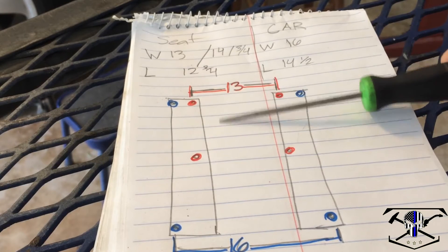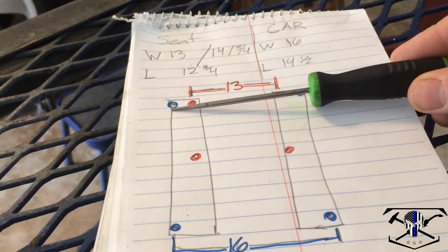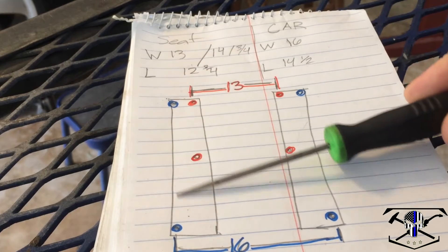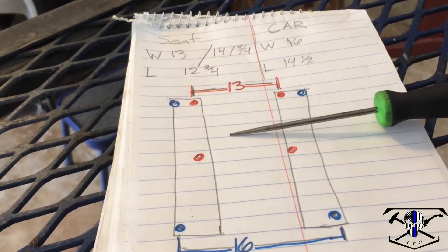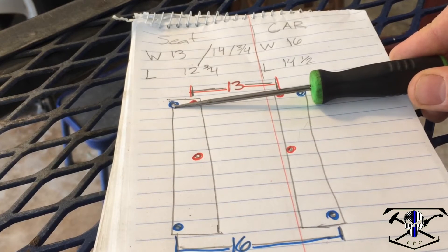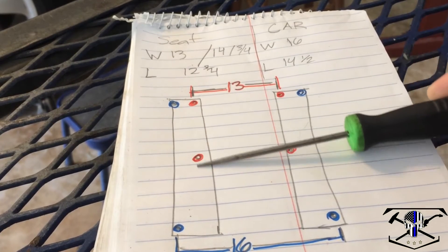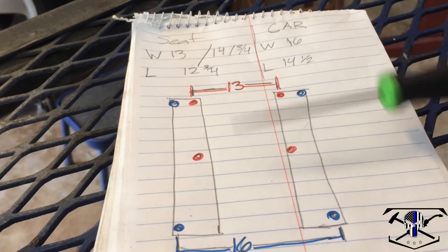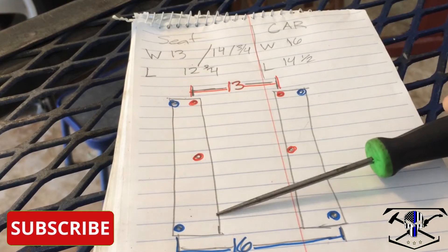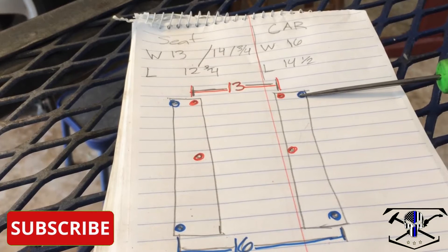Where this all correlates is where I've color-coded this — the blue being the car. These are my car measurements; this is where these bars are going to bolt to the car. These represent the seat brackets themselves, which are 2 inches wide. The reason for going 2 inches wide is so I can use the full 16-inch width for the outer bolts that bolt to the car, and the inner bolts are going to bolt to the seat frame itself. We'll use the 14 and 3/4 to make up the difference between the seat and the 16-inch car measurement, with inside and outside holes to line this up.